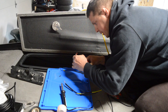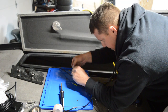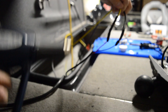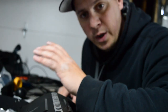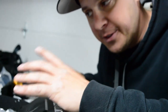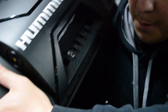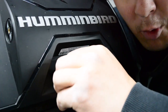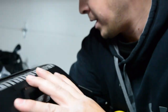I want my ends to be a bit longer, so I'm going to wrap those together and then grab the solder gun to solidify these two. Now that I've soldered them together, I've put the shrink wrap over it and I'm using a heat gun. Here are two tricks: a lot of people complain that the Humminbird shuts off while riding or hitting waves. The power connection is the issue — I use medical tape or hockey tape to go around this connection. Your power cable will be more sturdy and won't be as loose. That will fix the issue 99% of the time — people are blown away when I show them this trick.